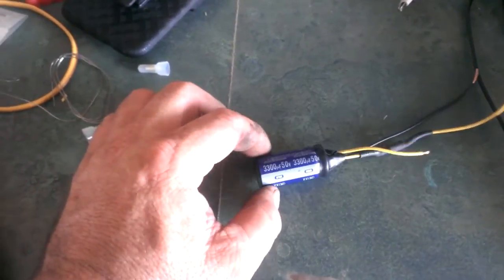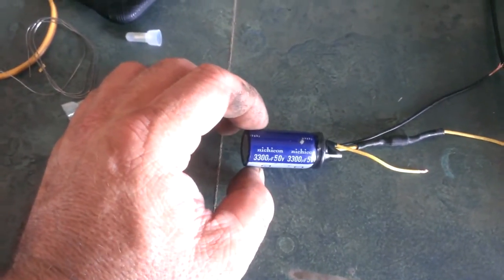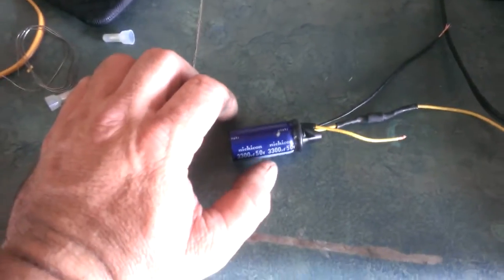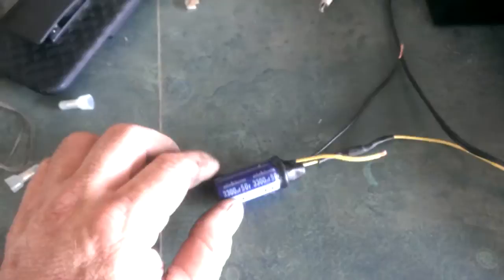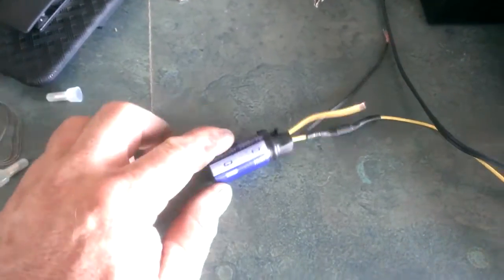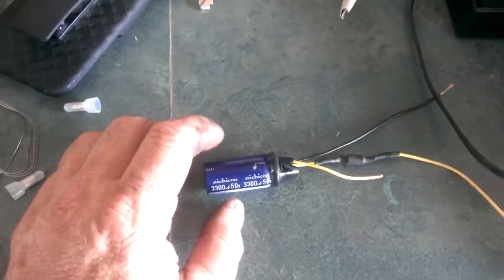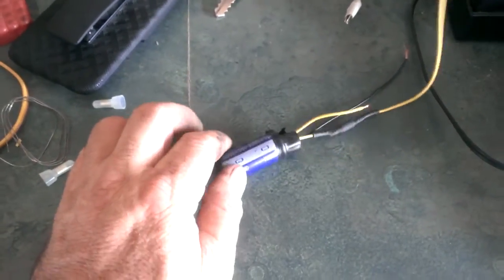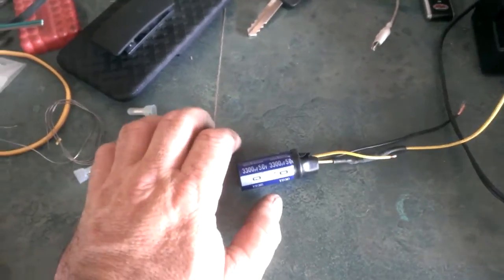It shouldn't be that much, so I don't know if this is going to hold the memory for a minute — it might hold for 30 minutes. I just want it to hold the memory long enough to take the battery, disconnect it for a few minutes, and discharge the rest of the system in the car to clear the car computer, which is something I haven't been doing because I don't like losing the memory in the radio.